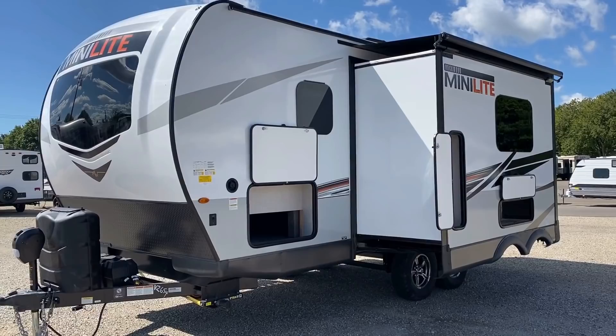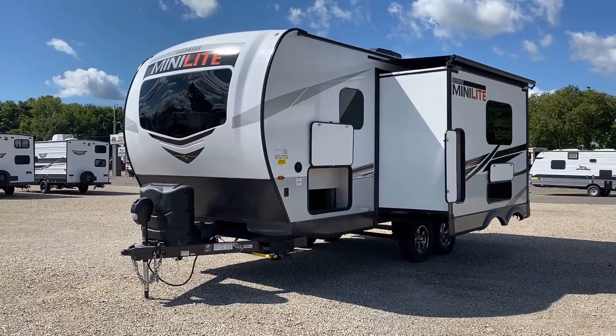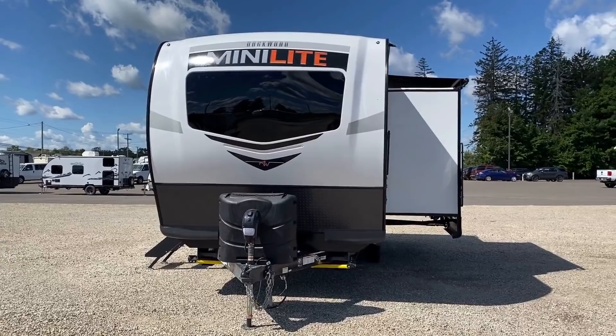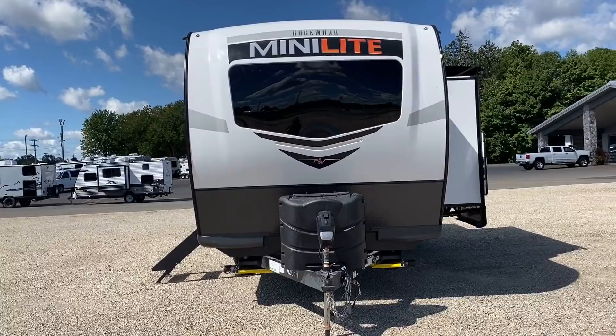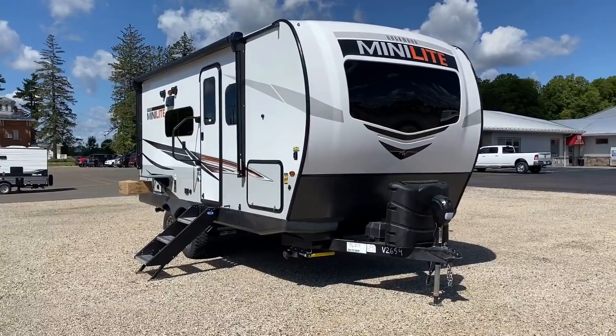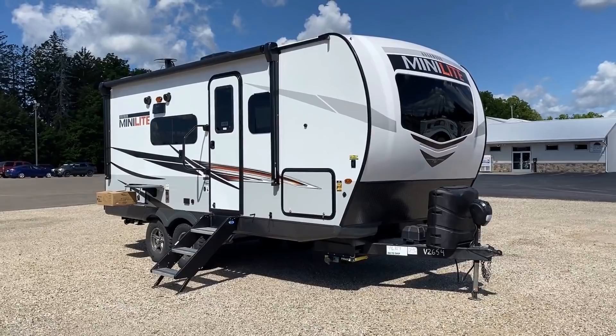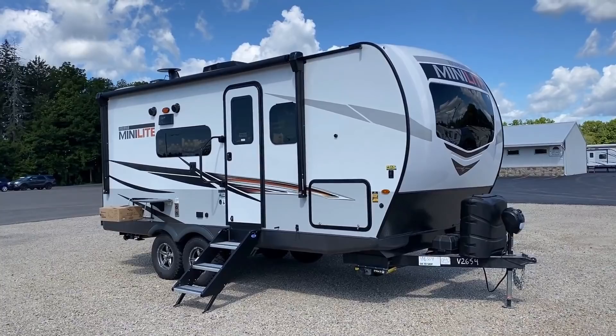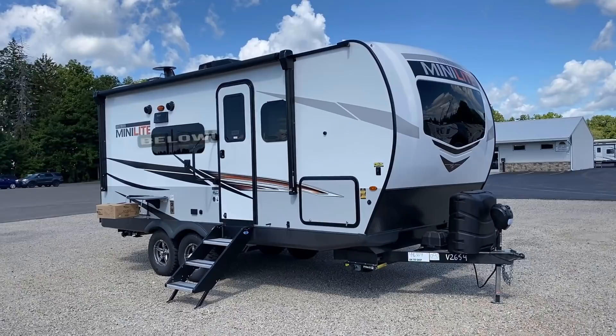It's a minor thing — it's not stopping me from camping. That's just how well-appointed this is, that as someone who RVs and has probably seen somewhere between 10,000 and 12,000 RVs in my career, that's the most I can come up with. There's so much more below the skin: even though that is a nose cap, it's still a one-inch laminated front wall to help provide a more even thermal barrier, and they're running radiant barrier material not just in the belly standard, but also up that nose cap standard. I'll leave a link in the description where I went through Rockwood's Mini Lite production facility from the chassis up.